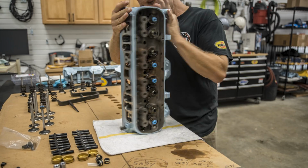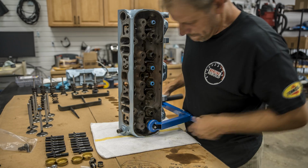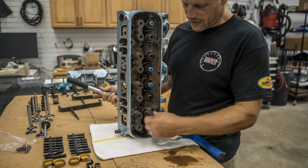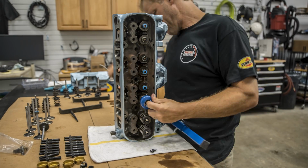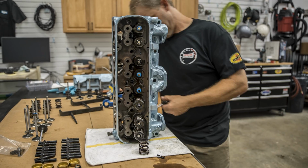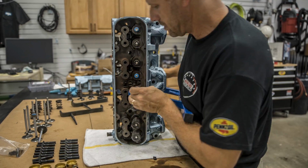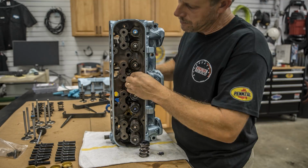Lots of times when a motor is burning oil or using oil, but you don't know where it's coming from, it's not leaking on the ground, it is these intake seals, because that's the side that has suction, and it'll suck it right down the guide because there's nothing sealing the top of it. Now a worn out guide or what have you will cause that.